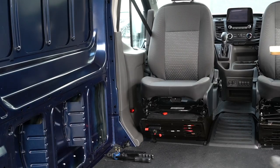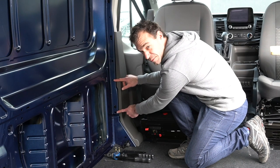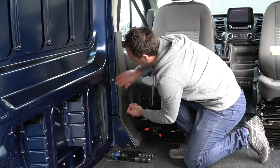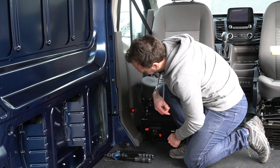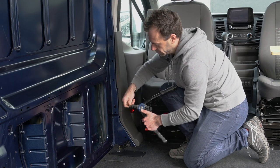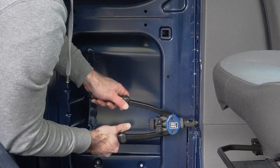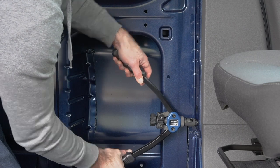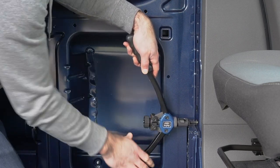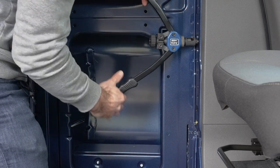Now the driver side is a mirror of the passenger side so the installation process is exactly the same, except for the fact that the factory holes are not threaded. So we first need to add M8 rivet nuts, which are included with the driver side mount plate. You'll find ways to install rivet nuts using a DIY tool on YouTube, but if you're doing a van conversion I highly recommend getting the proper tool — this will save you a lot of time and prevent installation issues.